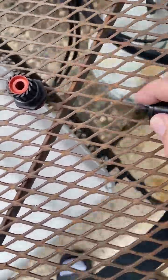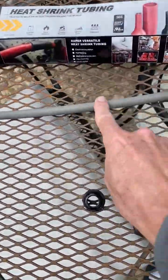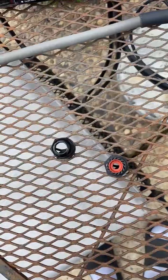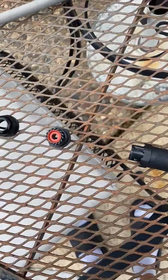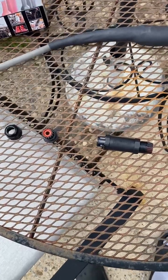This middle block fits inside the outer piece, and on the other end you've got the gasket and another cap. When you cut the cable, there's an outer covering over an insulated inner wire that carries the three wires, so you want to find a connector where that diameter matches closely. These connectors are also made for underground electrical use — landscaping lighting and things like that. Since this is going to be submerged underwater 100% of the time while in use, I didn't want any water getting in.